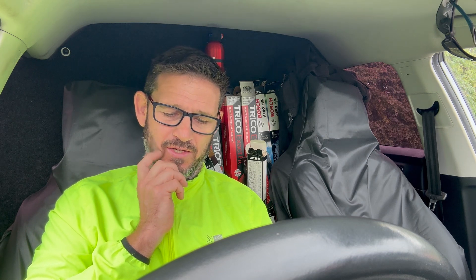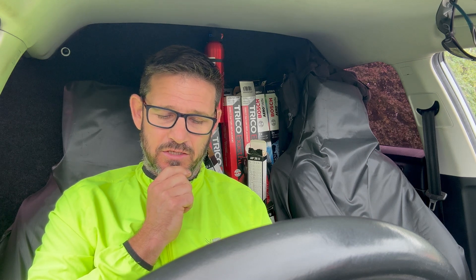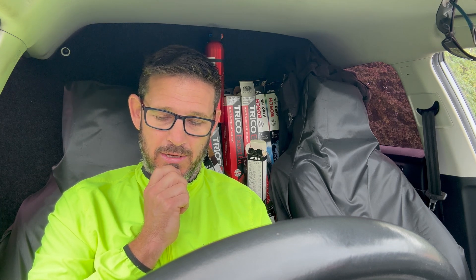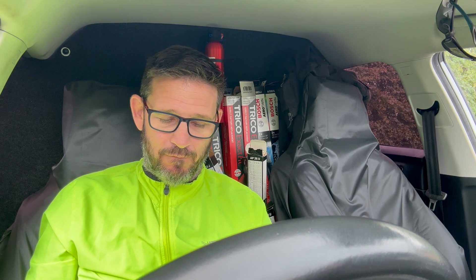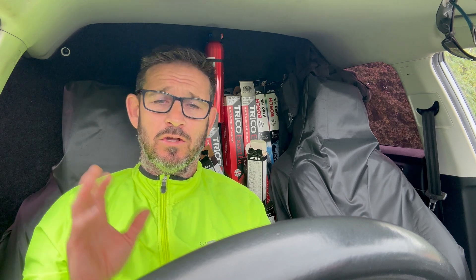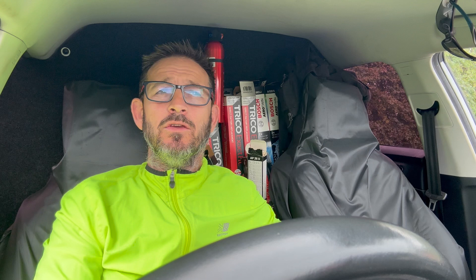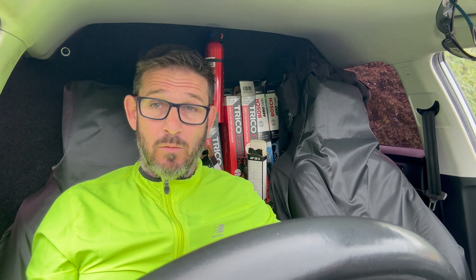Another guy's MG5 SR taxi is now at 147,580 miles and he thinks he's starting to see a reduction in range and wants to know the battery state of health. He also asks if you can put a long range pack in - and yes, you can. You can take a long range pack straight out of this car and stick it in an SR and it will just work. Everything's the same - the pipework, no coding required, just chuck it in. There are a few other EVs where you can do the same thing.